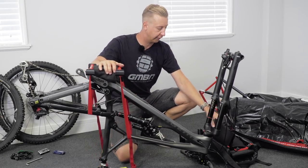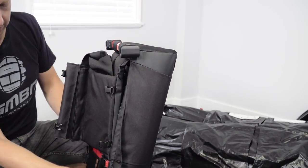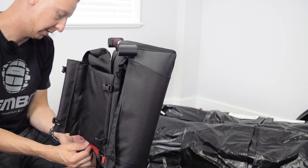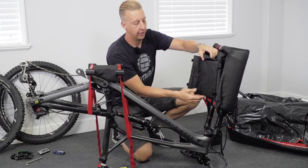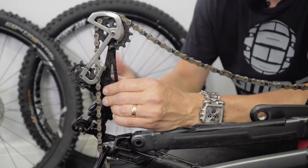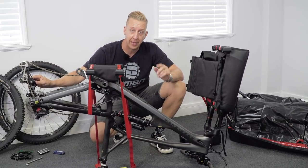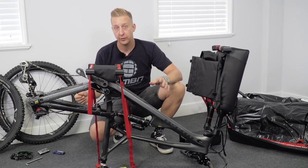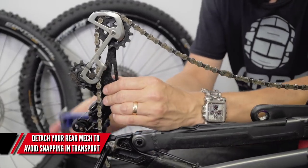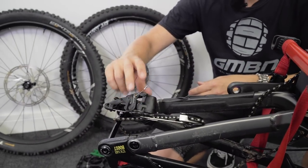Next up I just need to protect the front fork — they've got a block for this which is fantastic. It goes over the whole front of the fork, means nothing is going to get scratched, and you can secure it in place. This housing is for the handlebars inside the bag once I flip it the correct way up. Just before I do that, I'm also going to remove the rear derailleur from the bike. Whilst this is a very protective bag, there's still a chance your bike can somehow become dislodged or get trampled on. If your rear mech is subject to that, it's going to break your rear derailleur hanger or the rear mech. So just safeguard yourself — take it off, let it dangle, and it's all good.